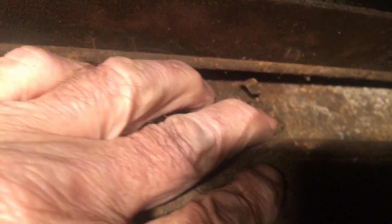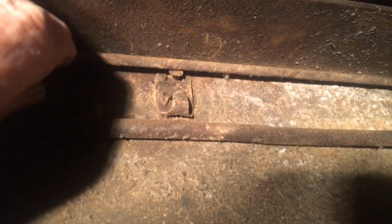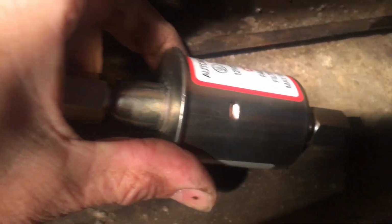And what else works out pretty good is that this hard line, this big line, was up underneath in there, and the brake line was there. Check this out. Pull these two away, go in here, and flip this thing around like that. Trying to focus, guys. There we go. Flip it around. Put the little one up top, and the brake line will click right into there. And then the fuel line eventually will go back there. And that's nice. I like it a lot. And the fuel filter then should be able to lay right there at a little bit of an angle like we like it, going up. Yeah, I think I like that.